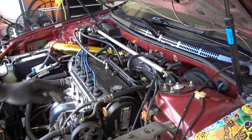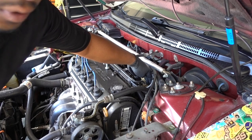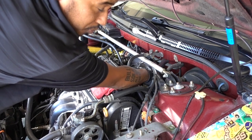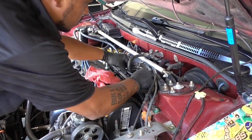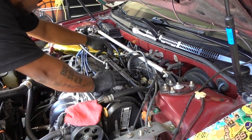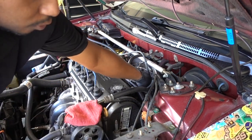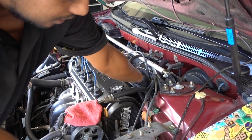To begin with this process, I have here the fuel pressure regulator — two 10mm bolts — you need to remove those to get the fuel pressure regulator out of the way. There is no fuel pressure in the line but get a rag in case you have fuel around the area. Fuel pressure regulator is disconnected. Now we can disconnect the EGR to give us a little more room, and then you can disconnect the fuel injectors. You have a little clip on the side — press on it and disconnect the fuel injectors.